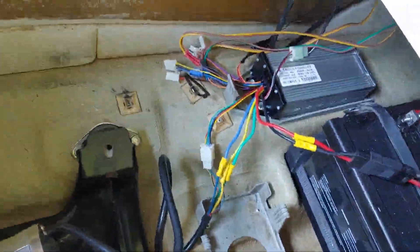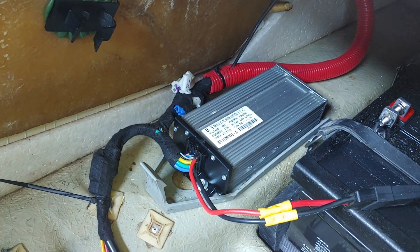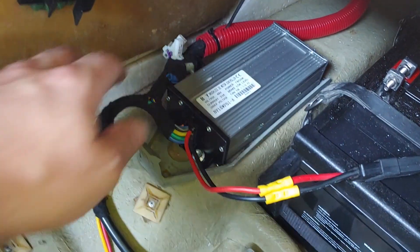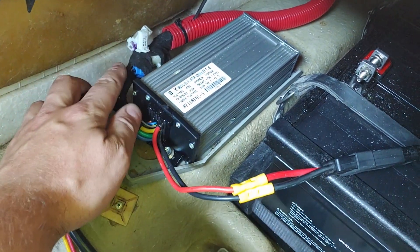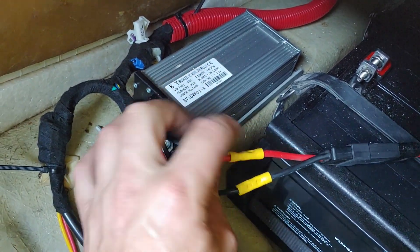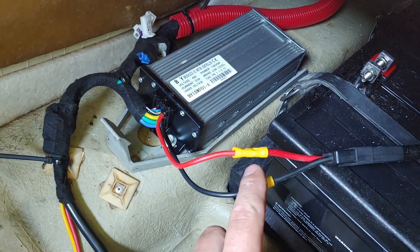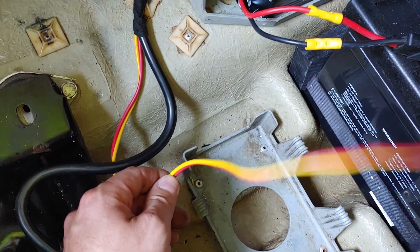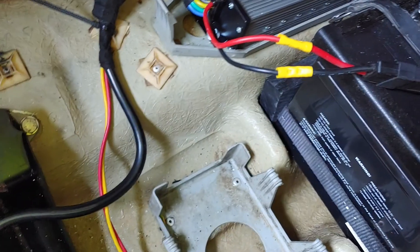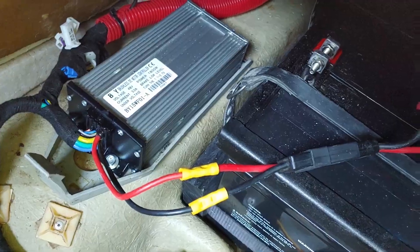Now it's time to stitch everything up and hide some of the wiring. There's the main control board wiring and the motor controller — it's not completely done yet, just temporarily in there. I really don't like the brake plugs since they'll never be used, but I hate to cut them off. I have to put a master cutoff switch in the positive side for the 48-volt battery. The bilge will still need to be wired in with the automatic bilge water detection system, and I'm about to wire up the speedometer on the 12-volt side.